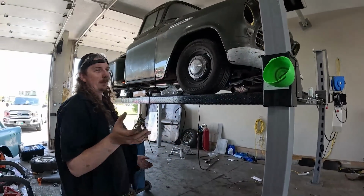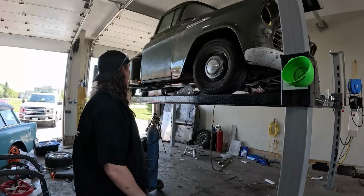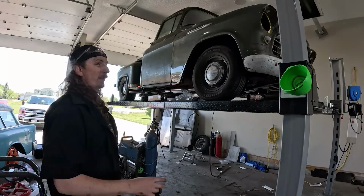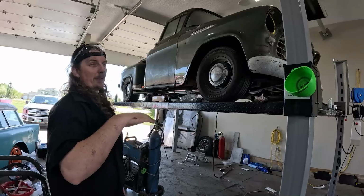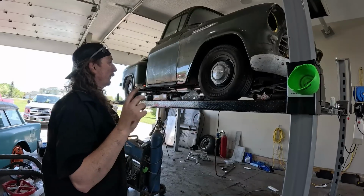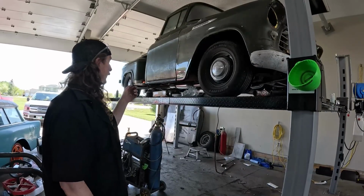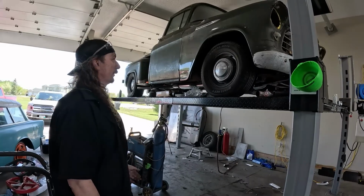I don't know what that thing weighs, maybe 3,300, 3,400, 3,500 pounds. I gotta assume they're probably similar in a lot of ways, but maybe this weighs more. That one is a little higher rev, so you've got the stick, but if you brought a different camshaft in there to bring the power down in the curve a little, with a bit of a converter, 12 bolts and different gears, you'd have a hot rod.